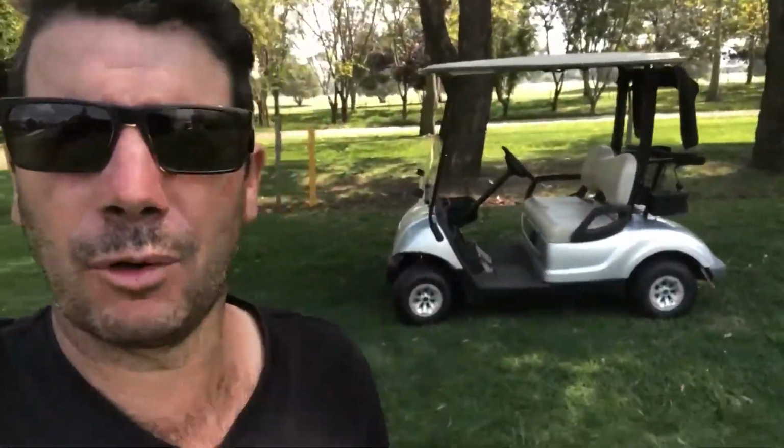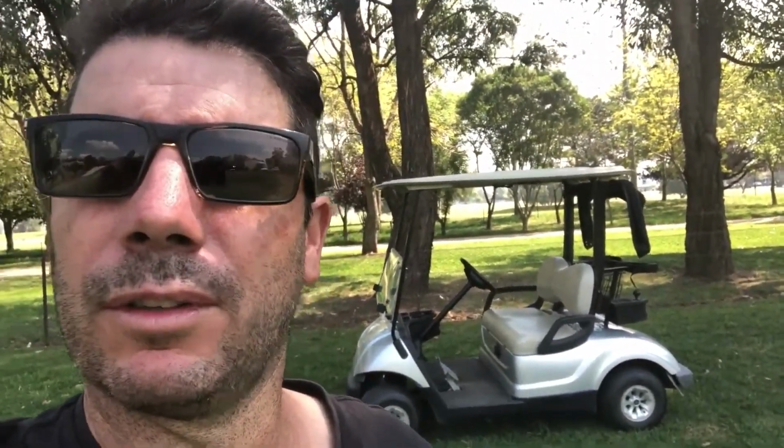All right, we're almost done. We'll put it back together. The kids have test run the cart. The surge is gone. So the repair work, as I said, there's different symptoms. Some not running at all. It's that model there, G29, runs from 07 right through. You'll probably find that repair works with the early ones, the G22s as well, and definitely works with the later 16s, 17s, the Drive 2, same motor.